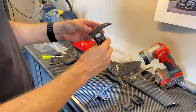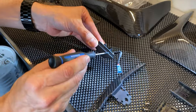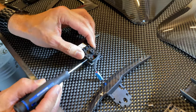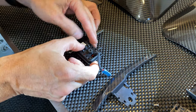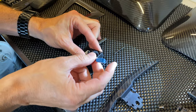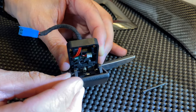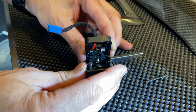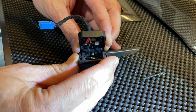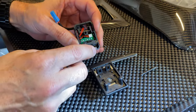We got them over on the bench. We're going to transfer the guts from the stock shifter over to the new one. There's a little pin that comes out both sides — there's a big end and a small end. Push the small end first to release the pin, kind of like adjusting a watch strap. Then swing it open very carefully because there is a little spring in there that we need to put in the same spot. When you lift this out, there's a pull-out-and-back action — pull toward you and out.